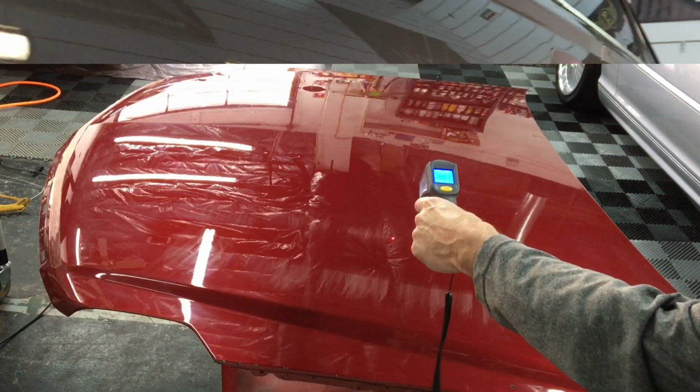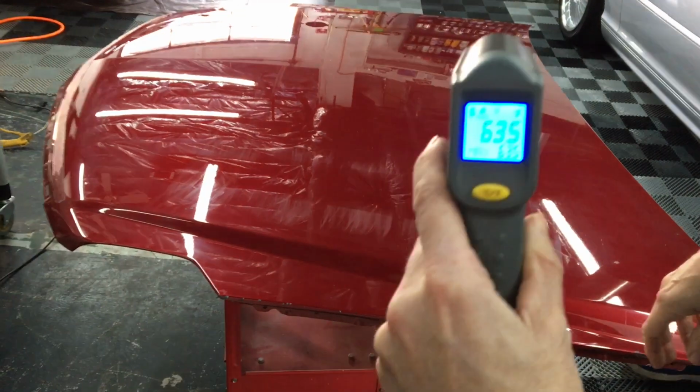And that's good news. We don't have to bump up aggression. We don't have to go to a microfiber pad or a more aggressive wool pad. We don't have to go to a more aggressive cutting pad, an extra cut pad. So we're not going to really be removing a lot of clear coat, and that is great news for this car. Let's pause, a timeout or sidebar, so to speak.